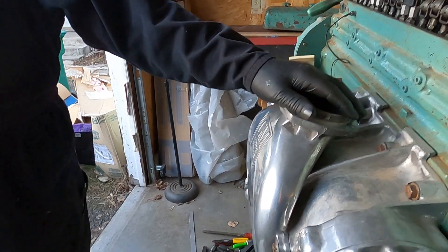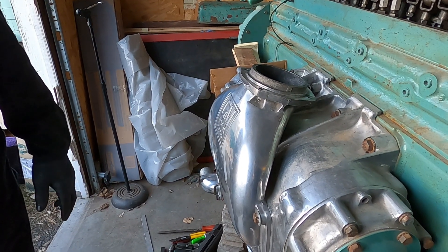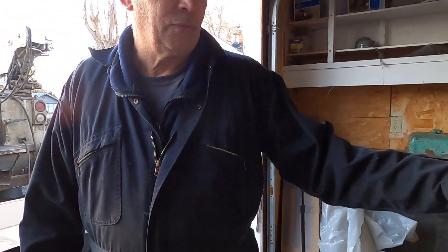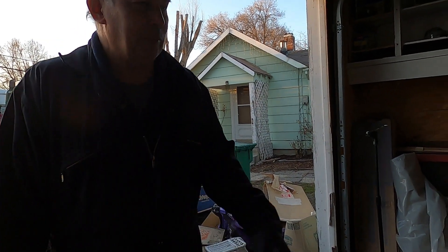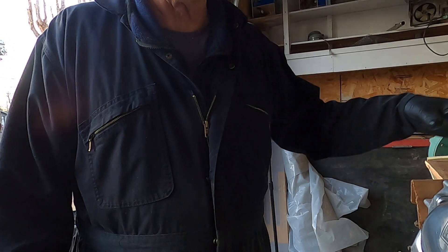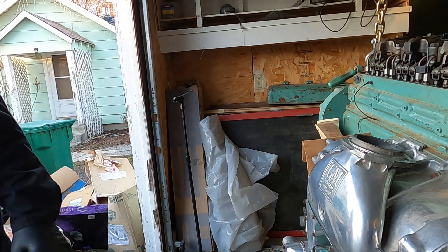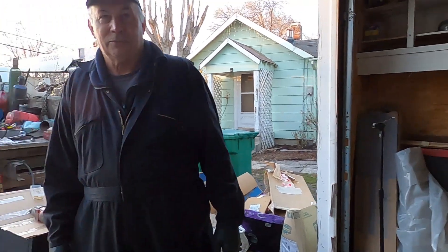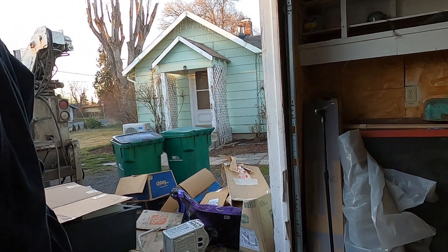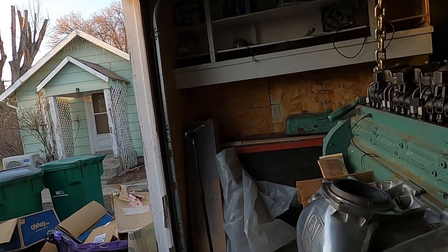You won't see them unless the turbo's pushing oil through it. It'll be fine. You polish it up so she looks good — it's one of those eyeball deals. You lay a taper in it so it looks like it was factory made, so it matches the inside of the pipe. That's what you're looking for. It would be like a race car modification — making it better. Maybe it's that extra little mile an hour you're trying to get at the end of it. It makes a difference in how all that stuff works.